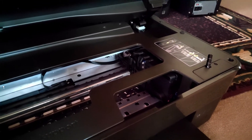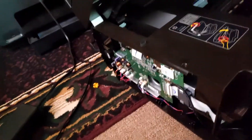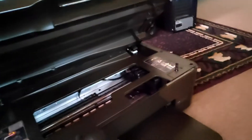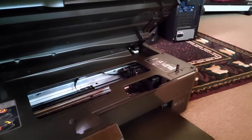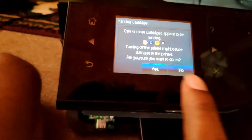See it move a little bit and then stop. This board, in its main memory, writes errors that happened on the printer itself to the board. This is the 7610 board that had the carriage error, so right now we're telling this printer it had a carriage error and it's not supposed to be moving. You can see it trying to move and stopping. This error has moved from that printer to this printer because of the board. Shutting down this printer — it read the cartridges.